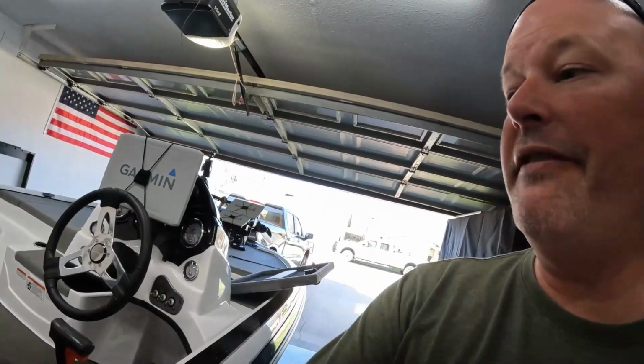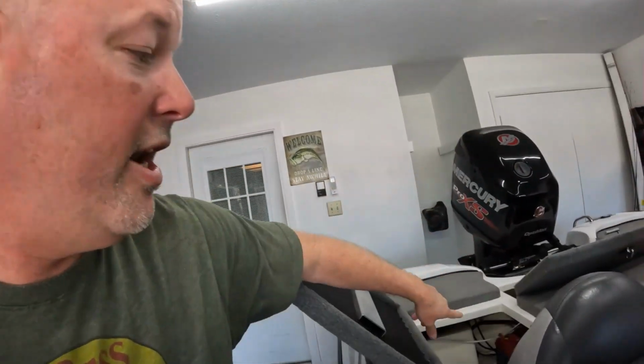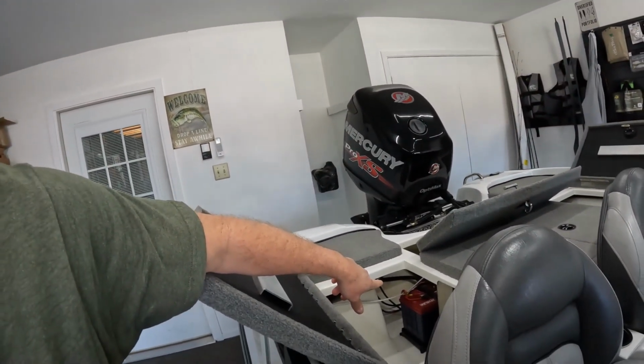So if you're thinking about, well, how much do I actually need? How many amp hours do I actually need? Which is a big question. A lot of people seem to really concern themselves with that. Hey, I'm here to tell you, I went multiple days on 135 amp hours, and yet some people are wanting to max out like 200 amp hours. You want to do a setup like this, 3 graphs, cranking battery, everything running off of just one 135 amp hour battery, no problems.